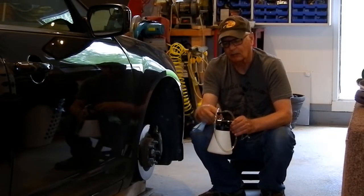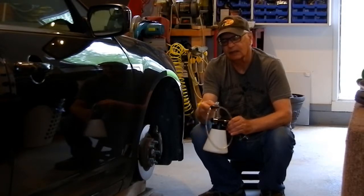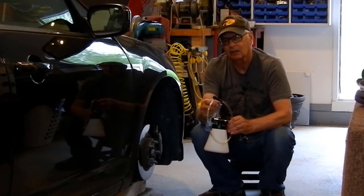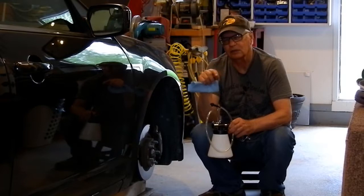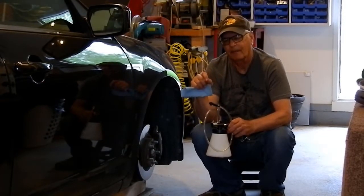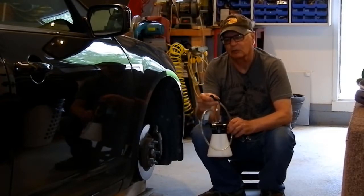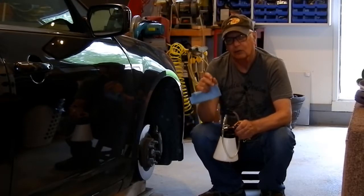Now, the problem with the vacuum bleeding is that you'll never get the air bubbles out of that clear plastic line as an indicator that all the air is out of your brake system. You can put grease on the threads, as some suggest, on the bleeder valve. There's always going to be air bubbles there. Not to worry about that.